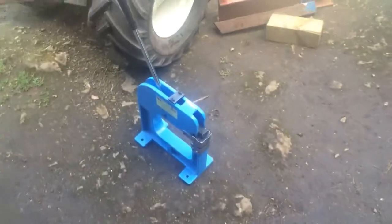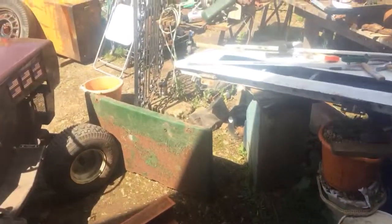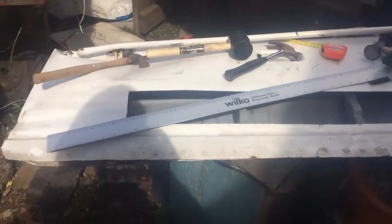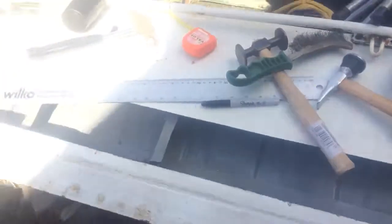Using my super duper little stretcher shrinker, and using an old gate that I hammered to shape as a former. I'm using a bit of a Bedford Brava tailgate which makes just the right contour upside down — so it is now the perfect shape.